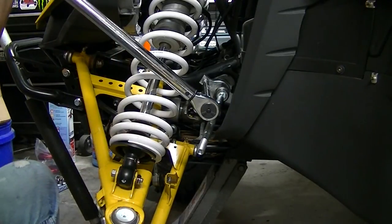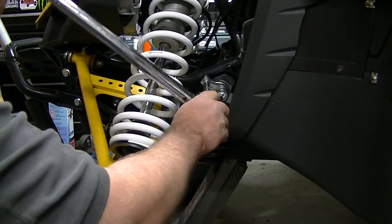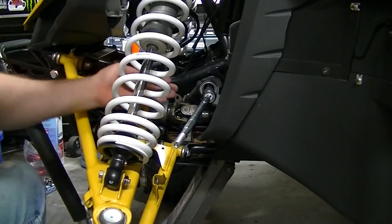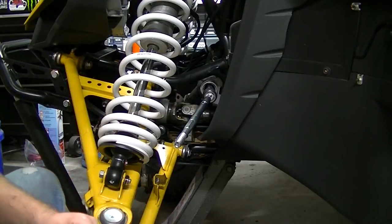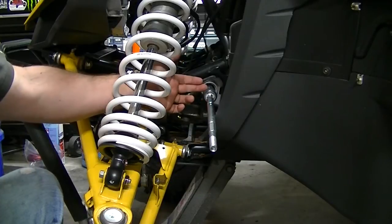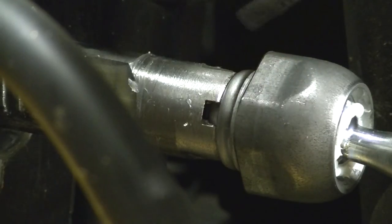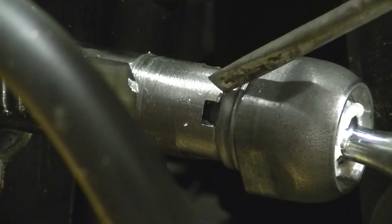Using the same configuration — 32mm crow's foot on the torque wrench — we'll torque that down to 40 foot-pounds. The only thing you've really got to be careful of is that the tabs on the locking ring go into the indentions in the steering rack. Now that I've got this torqued down, I'll pin the four little notches. That little notch right there — there's one here and one on the backside — that's what those two ears sticking out of the locking ring go into.